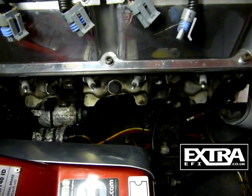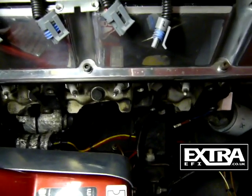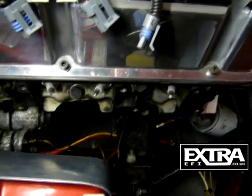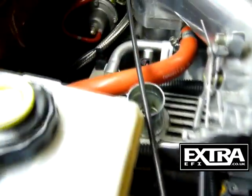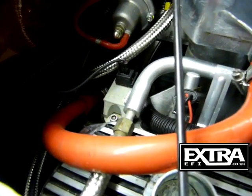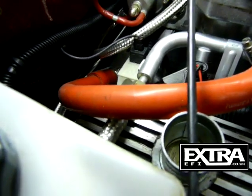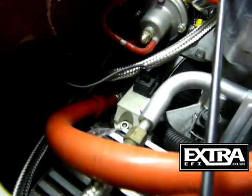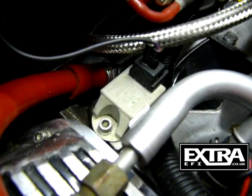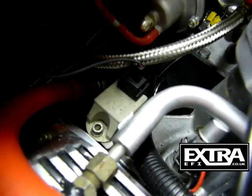Other basic requirements are resistive spark plugs - basically NGK spark plugs with an R in them. I always recommend NGK. You'll also need, if you're running any coil packs directly off the MegaSquirt - like a Z-Tech coil pack or anything like that - when you're directly driving an ignition coil, you want a capacitor that connects to the 12-volt feed going to the ignition coil. That's the version I'm using on my car and there are various other versions, but this one is bolted to the engine.